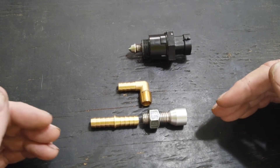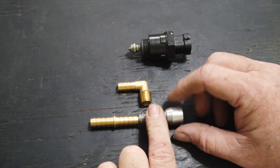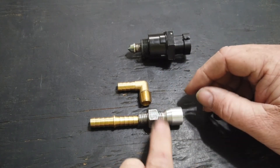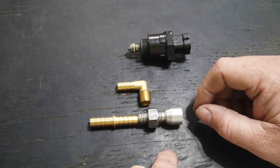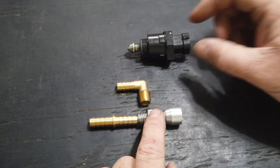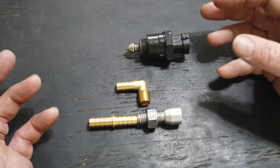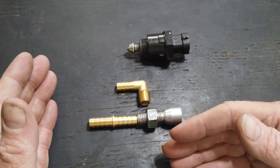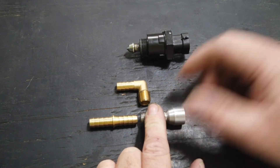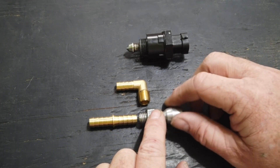Home steps is how far we're going to drive this valve to make sure that it's closed. When we first turn the key on, it'll drive this valve all the way until it stops. We need to tell it that we want the number of steps it tries to drive to always be larger than whatever it might have moved. In my example, I have 150 steps for home steps, so it tries to drive 150 steps. If it only moves 50 steps and then hits the physical stop, the solenoids will keep powering it — what's called miss steps or skip steps — and it'll try all 150 and then stop. When it stops trying, that valve is going to be closed. Then from there, when we go to set our position and we need to back it out, say 10 steps, it'll send 10 steps and that'll be that position. As long as we don't hit a physical stop again after our home steps, we'll always know the position of that valve by what we drive it to.